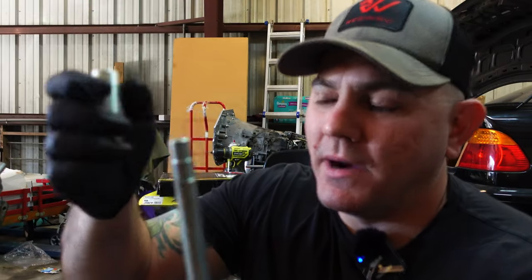Let me give you a rundown of events. Yesterday went smoothly most of the way, except when I was going to align the clutch — it didn't come with a clutch alignment tool. Went to grab another clutch alignment tool — not the right one, too many splines. Went to two different auto parts stores. Found a clutch alignment tool with the right splines, but not the right pilot bearing size. So the next day I have this crazy contraption — you can actually adapt the pilot tool. You put this in there and you should be able to align it. That's what we're going to do today.